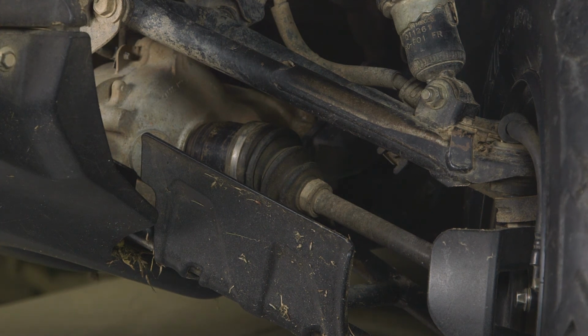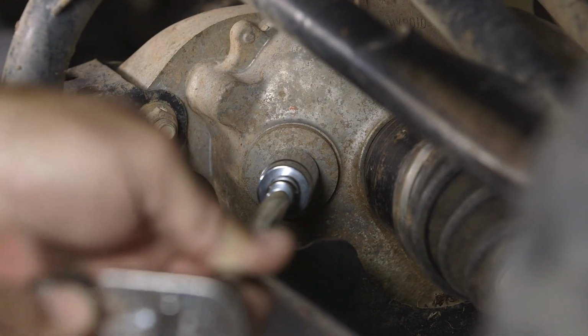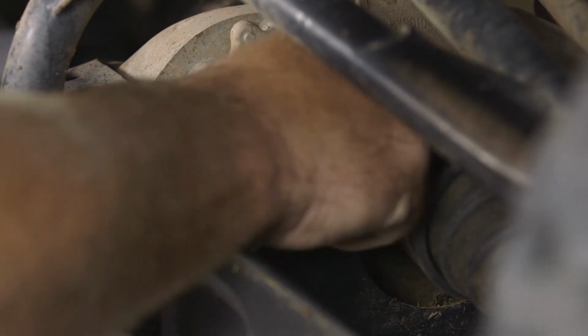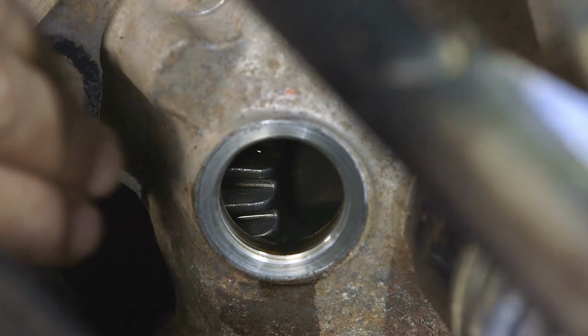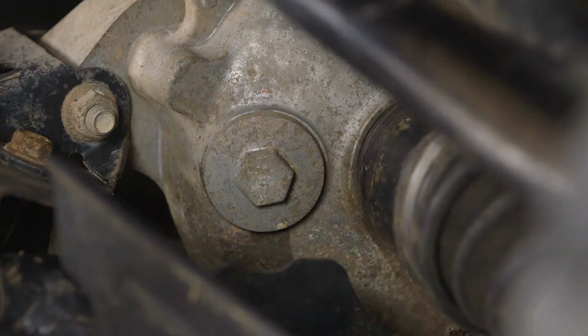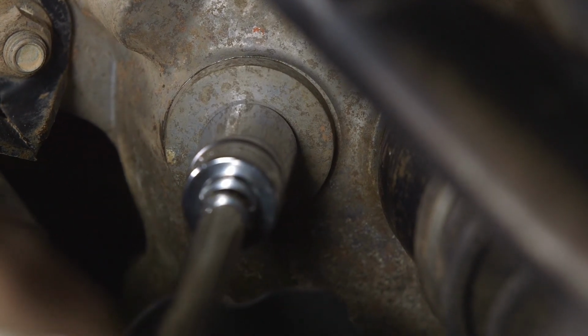And the fluid level is very important, and to check the fluid level on this specific model, you remove the fill plug, and the fluid level should be right at the base of the threads that are in the casting here, which it is, so our fluid level is correct. And then reinstall our cap. And of course, torque per our manual specs.